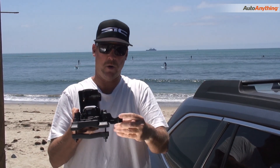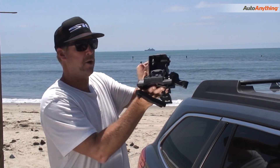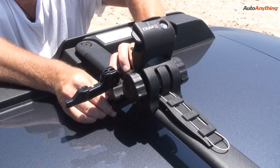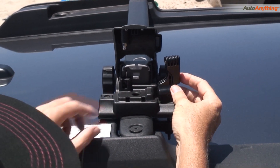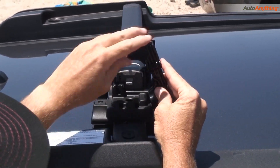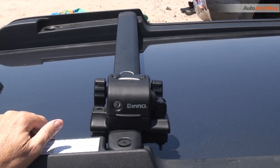Now we're going to show you how to install the ratcheting unit onto your factory crossbar. Go ahead and open up the top — it's going to click when it's fully open. Take this lever, bring it all the way over, and you can see where the bolt hangs down with this leg that captures it — that drops right out. Then move it over to your rack, swing this leg wide, then back underneath. Once you get the ratcheting unit lined up on your racks, to lock it down and close it, use this lever here. A nice thing about this lever is you can actually open it up to get a better angle when you close it. With the arm extended, close straight across, bring the arm back in, and then snap your lid shut. It's just that easy.